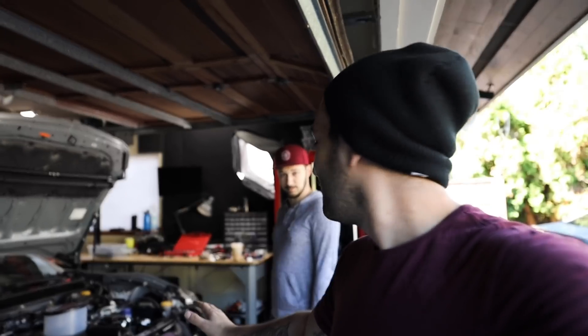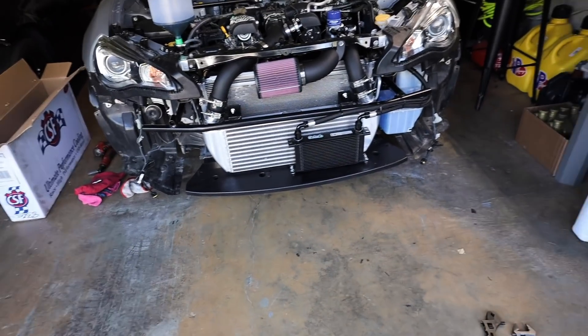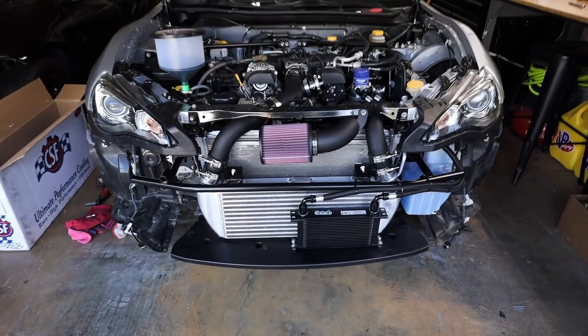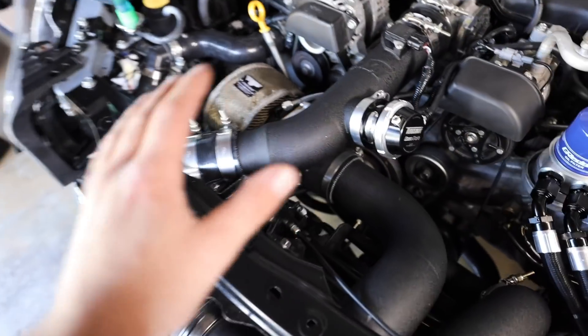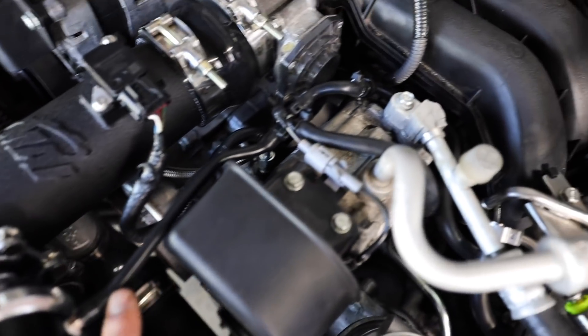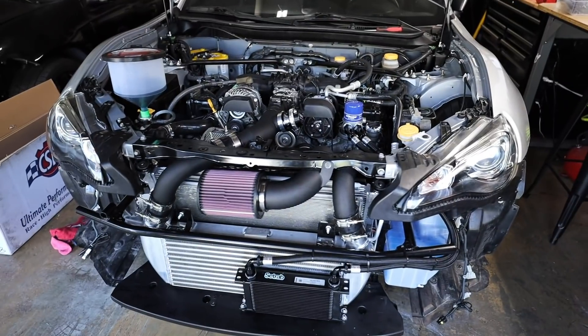I'm wearing a different shirt — it is now the next day. Last night we pretty much got everything put back on for the turbo kit. This morning I had one or two small things to finish, like hooking up the exhaust and putting the oil cooler back on the car. We did end up moving the oil cooler location since we were able to finagle the lines enough. We pushed the oil cooler more over to the right so we have more intercooler area. Got the core support back on — this is the modified core support so the intake actually bolts up to it. All couplers, turbo, everything is good to go. Downpipe's on, full exhaust is hooked up, oil cooler lines are back on, vacuum lines ran for the blow-off valve, teed off to the boost gauge in the car.